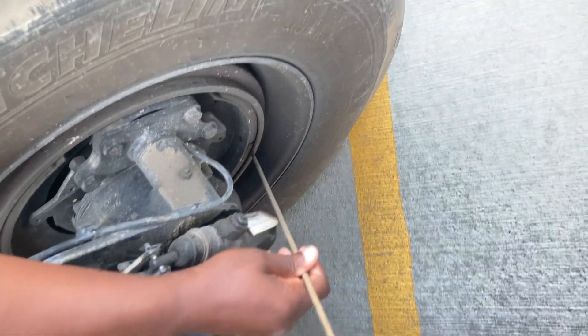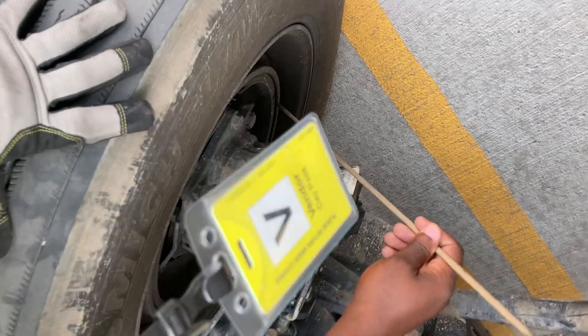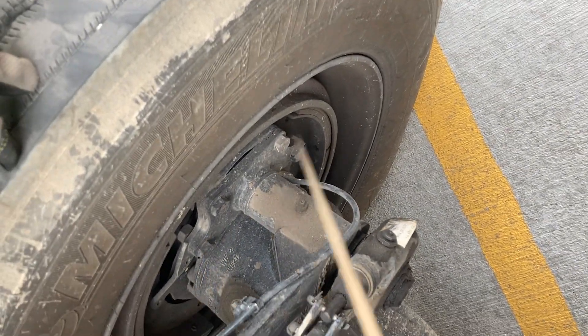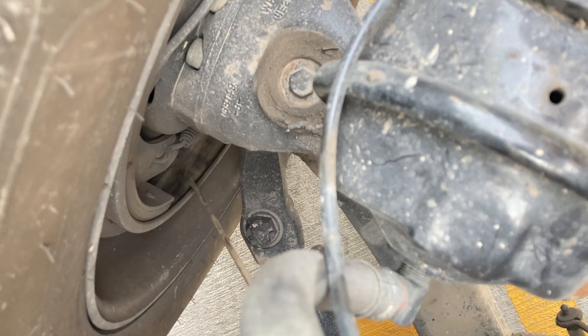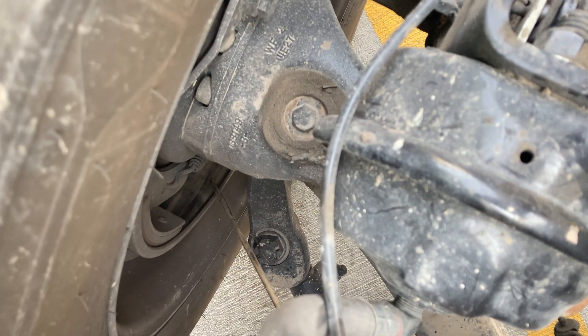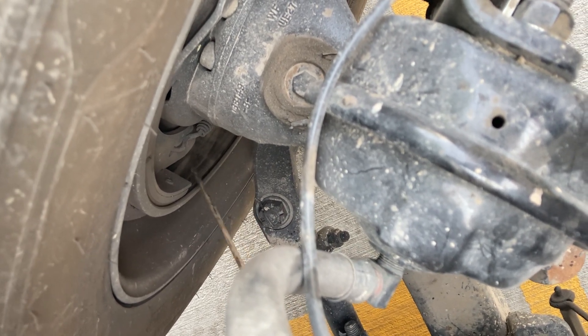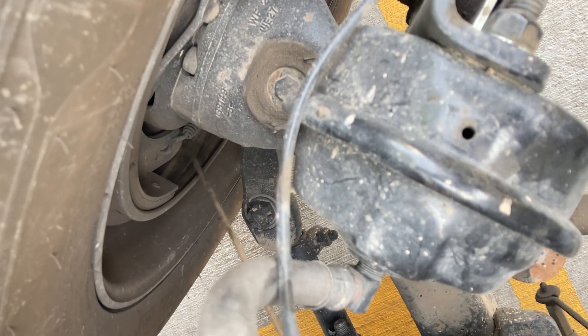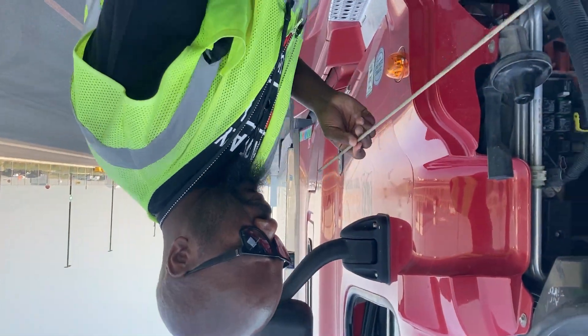From there we come into our brakes with our brake lining — you can see it's segmented into pieces. We want to make sure they are all present and intact, with no pieces missing, and there's at least a quarter inch of material on each of them. Then we get into our brake drum, which goes all the way around — it's the shiny material visible here. Our brake drum is properly mounted, not cracked, broken, repair welded, dented, or damaged. There are no oil or contaminants in the drum, and there are no heat stress cracks.